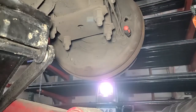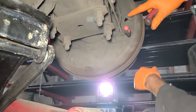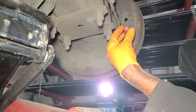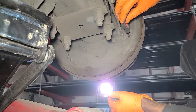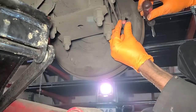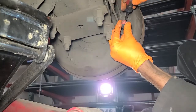Alright, there we go — got our camera a little better set up. We're going to follow the arrow, and the arrow is the way you want the gear moving. You're going to kind of push your screwdriver in, feel where it bounces just a little bit — you can feel the spring on it. Push and hold the screwdriver inward. And here it's clicking — we're turning the gear.